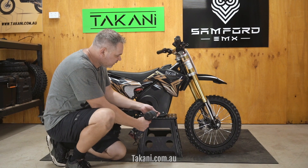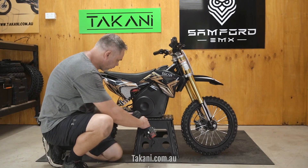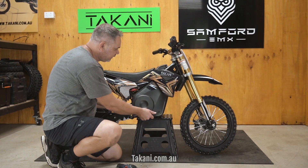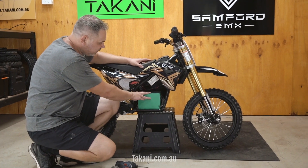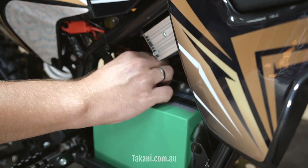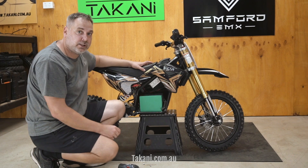To check that, just open the cover, take the two bolts out and pop the cover off — they're clips and it just pops off like that. The battery should always be well positioned here and held down by these two rubber straps. They should be nice and tight, and the battery should be nice and tight as well.